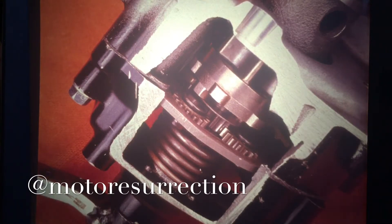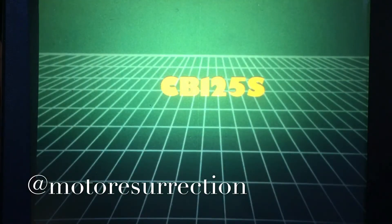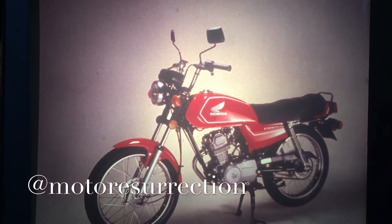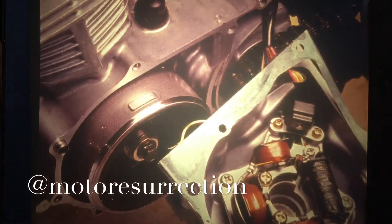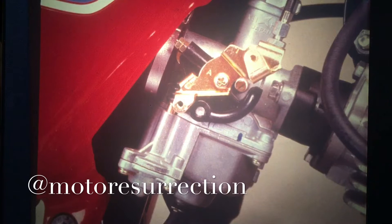That about wraps up what's new from the service point of view — almost. The CB125S is back from hiding in Brazil, which is where this one is manufactured. There hasn't been too much change from the last CB125, but CDI sparks the engine now and it's triggered off the crankshaft rotor. There's also an accelerator pump on the carb. Aside from these items, the bike is a familiar workhorse.